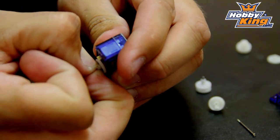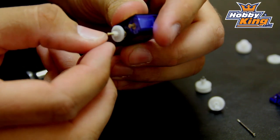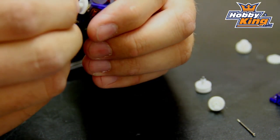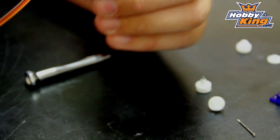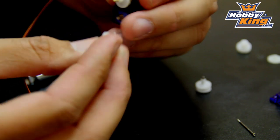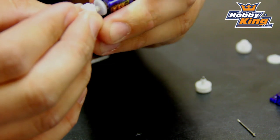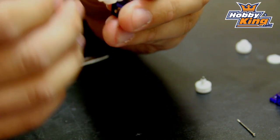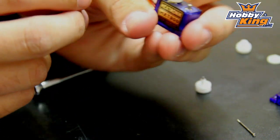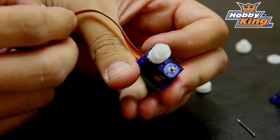You don't want to let that piece settle all the way because you need to look in there and see where that V-shape is. Make sure that V-shape is in line with the wires, then take this gear and line it up as well. Go ahead and do a light press with a little bit of pressure — it'll go on and it should stay. Now you have the piece with both gears press-fitted and lined up towards the wires.